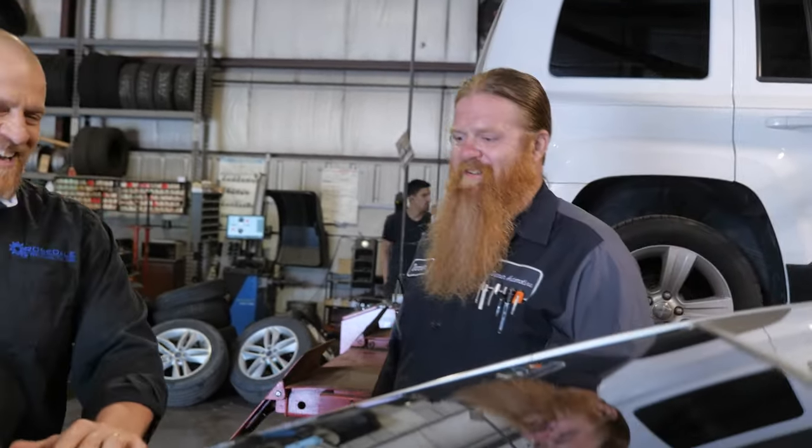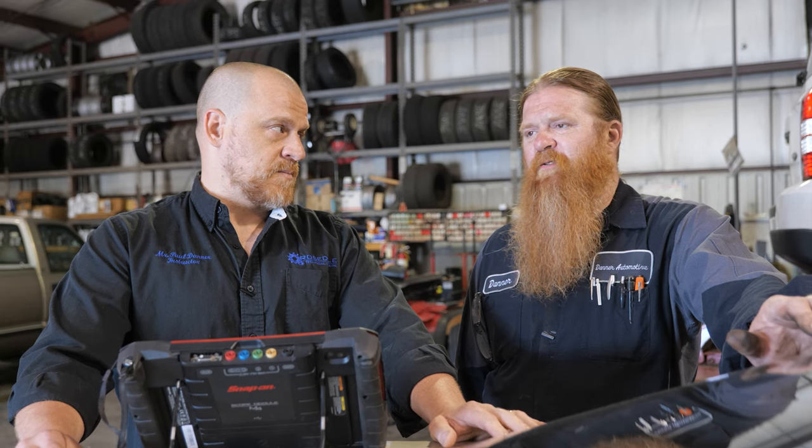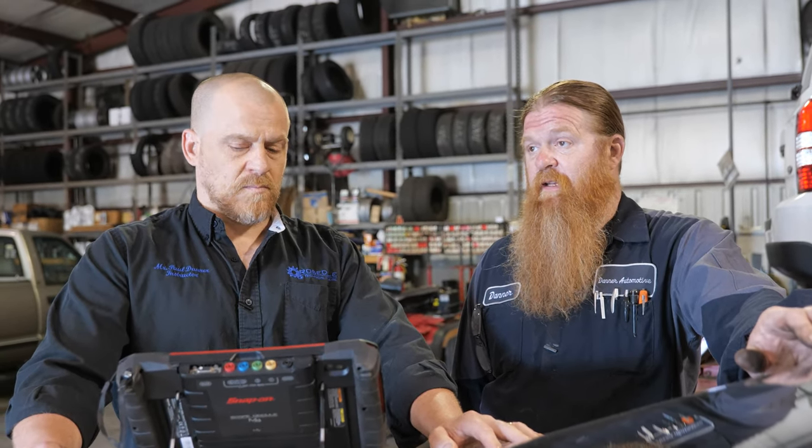I'm just tired today. So, O2 faults. But what was the history before you got this car? All kinds of parts. They had variable valve timing solenoid codes. I don't know why they did the O2 sensors. He said those were done. What it's doing, if you start it up, it runs good for a minute or two, and then it starts stumbling. You can watch the fuel trim go super negative, and then it stalls.